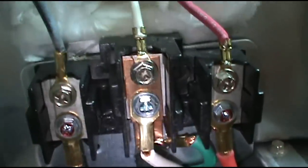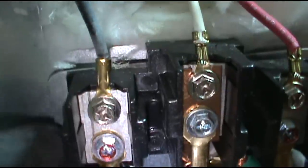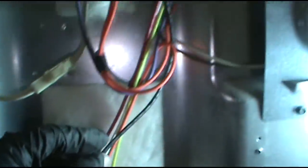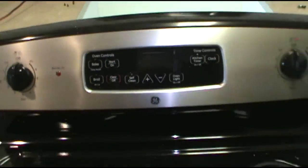Alright dudes, I got the new terminal block mounted and wired up. No more char. I ran a new black wire. That black wire connects to this switch, this switch onto the motherboard, daisy chains to this switch and this switch — this is the one that was all charred and black, I just put a new one in. Alright, I'm fired up — should be good to go. Alright, that's always a good sign. We have power.